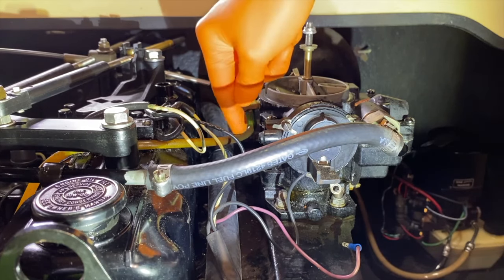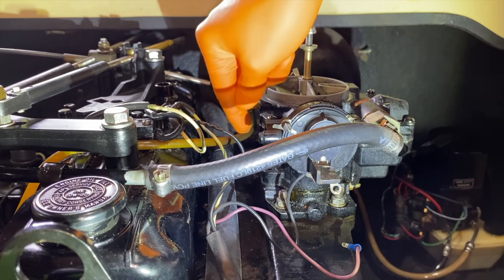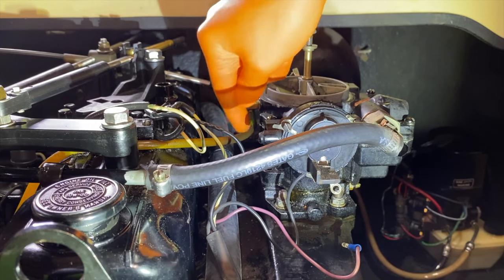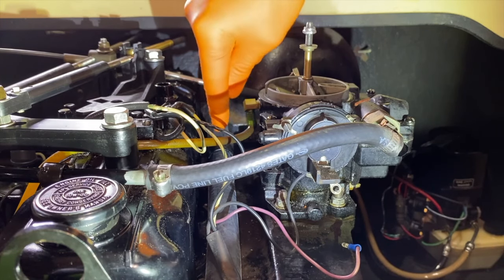And we have a sight line or fuel sight hose that again allows you to see if there's any fuel inside this hose feeding from here all the way down to the fuel pump itself. And as I mentioned a bit ago, if there is, that entire fuel pump housing needs to be replaced because again, the diaphragm has failed. However, I'm going to carefully push down on this hose at this fitting right here to pull it off of the elbow fitting without breaking it.